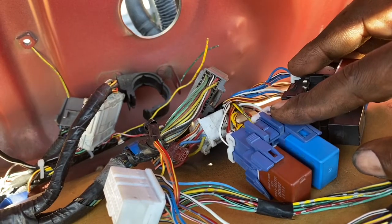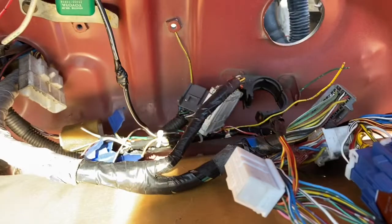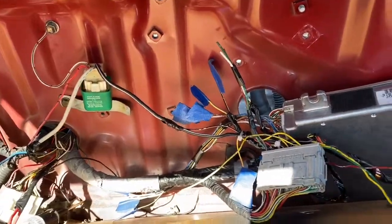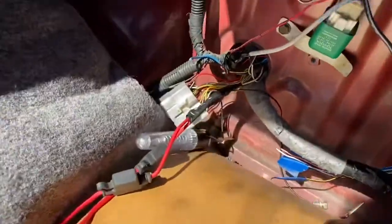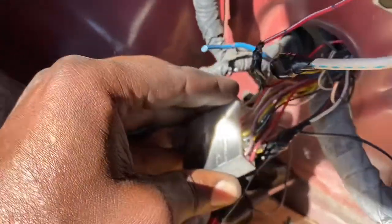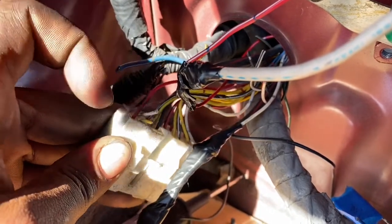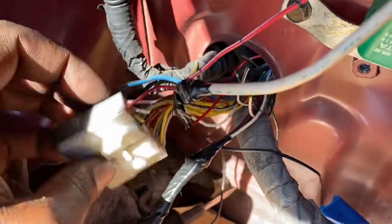After I do all that we'll be able to see what else we need. I'm gonna find this wire and come back. I've got the ECU in here to see where all my wiring is going to be going. I found the white wire that came off of this plug. With this plug, it's the fourth one — the wire below the alternator wire is white on this plug for this year. I tested it and that's my switch power.